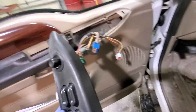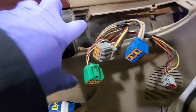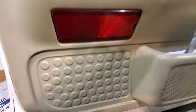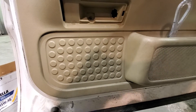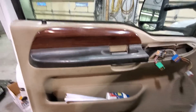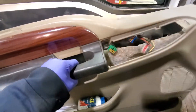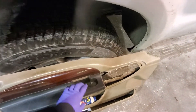All right, that was easy — took like 10 seconds. Get that off, get that unplugged. There are two screws that hold this panel on. One screw is right here once you take that switch bank off, and the other one is right behind this reflector. Take a little trim tool or pry tool, get into that slot, and there's a screw right there. Then all you do is lift straight up — that easy. Don't pry out, you've got to lift up.